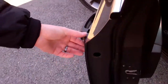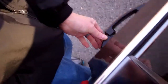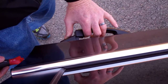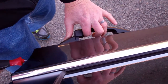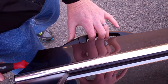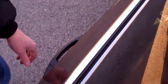Get your T20 Torx driver. You may have to loosen again or tighten if you slightly passed the position that allowed it to come out of the door. Once it goes in flush, hold it in with one thumb, hold out on your handle, and tighten the Torx screw. Never apply too much pressure to the Torx screw. Continue to feel for when the handle will fall back into place, and tighten until you feel light resistance. Just a couple of fingers is enough to turn it far enough, and you're done with that part.